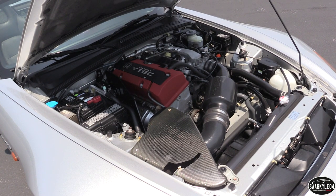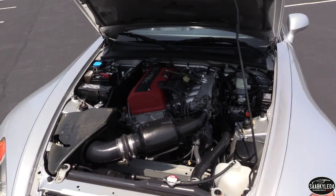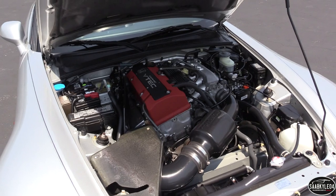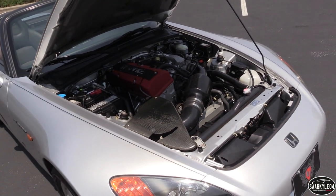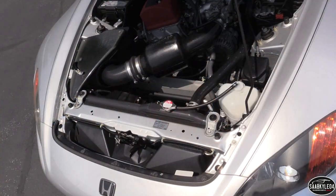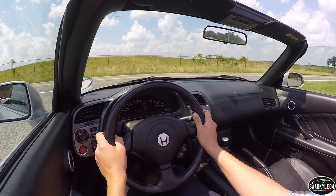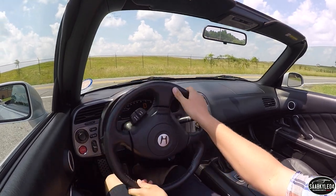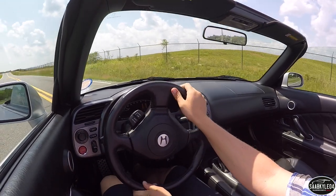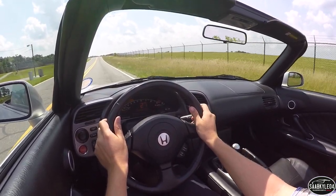Honda really went all out with clever engineering solutions when it came to designing this engine. Some of the more advanced components used include forged aluminum pistons, a first for a Honda production automobile, in addition to forged steel connecting rods, a forged steel crankshaft, hollow camshafts, and a cast aluminum oil pan. Bore and stroke measures 87 and 84 millimeters respectively. Along with a number of friction-reducing measures, including but not limited to roller-bearing cam followers, special attention was paid to keep the engine as small as possible without sacrifice in performance.